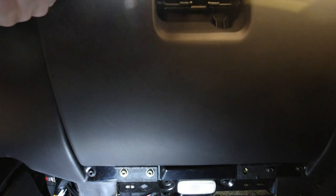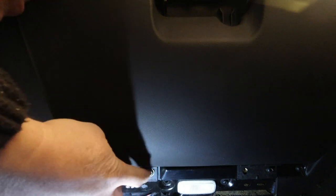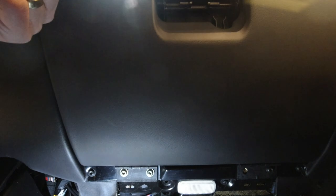The screws in question: there's where the handle of the glove box should be. If you go down either side of the light in the footwell you've got two bolts there, and there should be two bolts here but I've already removed one of them. Undo those and you should be able to get your glove box door off.